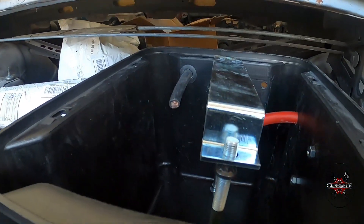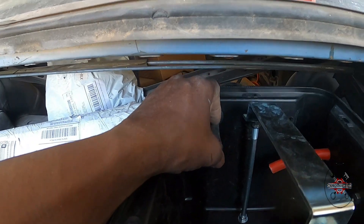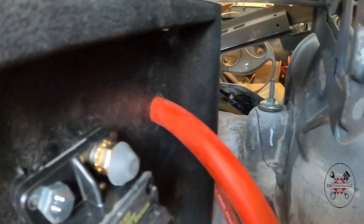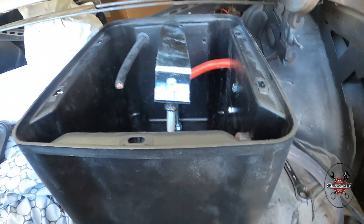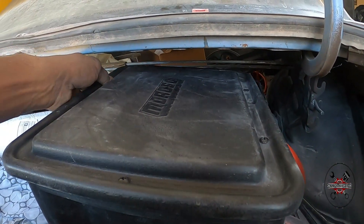All right, we got it all done. We have it here — as you can see down in the box, you can put bolts in these as well as these two here. We're gonna have our negative coming in through here, going down back there through that grommet. Then we're gonna have our positive come through here, hook into our fuse, and from our fuse going back out. And here is our vent tube. I mean, it's not hard to do. I gotta fix that hole back there — I'll plastic weld that hole.